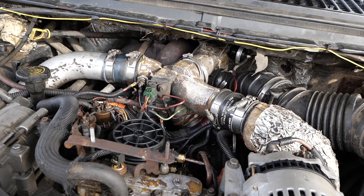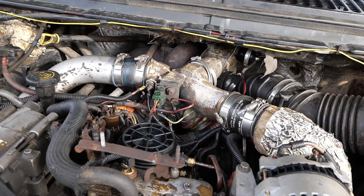Get it back together and I'm going to go underneath the truck and see what I can find as far as leaks. This is basically a prerequisite task to finding oil leaks on your truck. You do not want to go looking under the truck before you go looking on top because it can yield very frustrating results. It is better to make sure the top side of the truck is clean, working your way down. The oil is still going to leak down more. From front to back in the valley — the valley in the middle of the engine — there are four pockets.